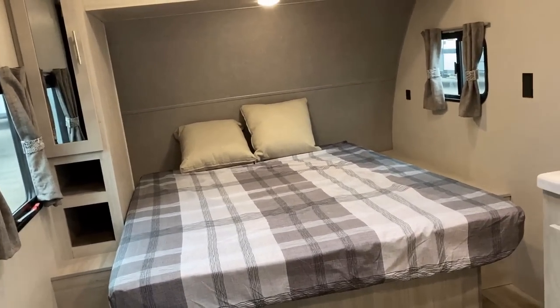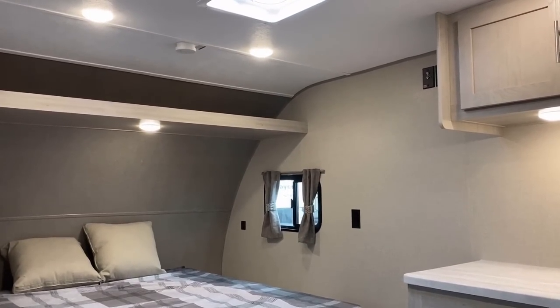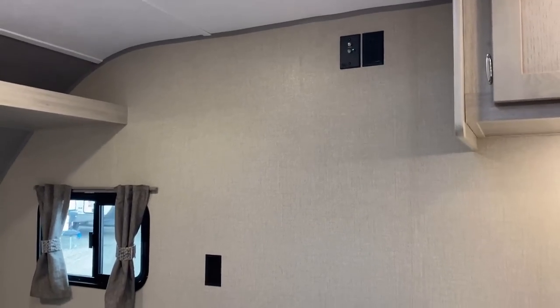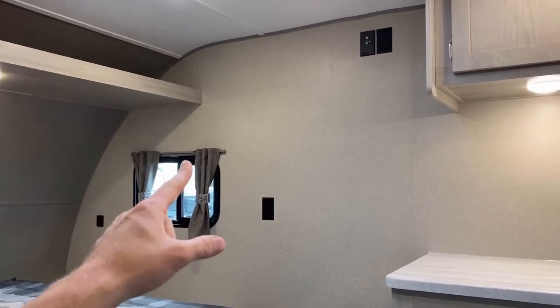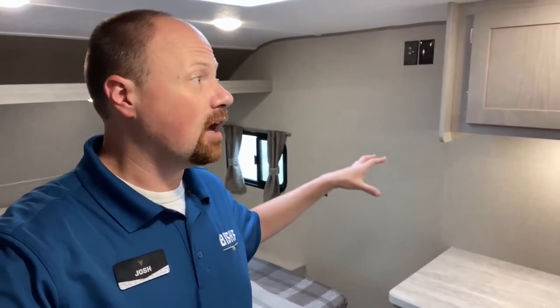Keep in mind, in this class and this budget it's not really made to be a 'sit in the camper and watch TV all day' kind of thing — the outside has some really cool exterior party functions. Moving to the left you get a better look at where the TV hookups might be. This is a stick-and-tin camper and there are a couple of benefits that don't get enough credit: because the walls are not glued and pressed together, you can run wiring in the walls, which is why you see all kinds of power outlets in the sidewalls.